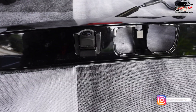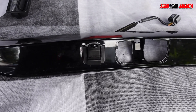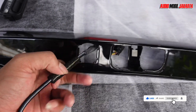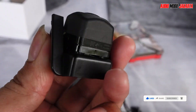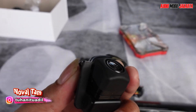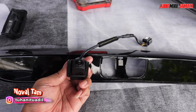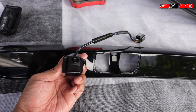This is the original rear camera lens, or reverse camera lens, of the original Honda CR-V Turbo — it's located in the trunk lid here. We disassemble the trunk lid and remove it. This is the original camera mount. We will remove this lens, and the 3D Plus camera lens will be placed here as well. So it goes back to the original position for the rear camera section. It will be connected at 4 camera points — like the 2 mirrors left and right, which have cameras underneath, plus the front camera — they're all connected as one unit.